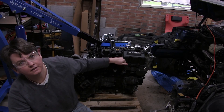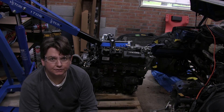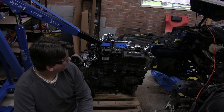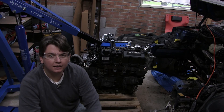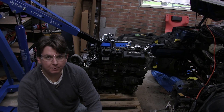It's exactly where I left it — I haven't touched it since. Goal today is to get the transmission off and take a look. One of the things we did try is turning the engine by hand, just putting a socket on and trying to turn it. It's a no-go, so something is definitely seized in there. Whether I'll get the engine up on a stand and opened up today, I don't know, but we'll give it a try.